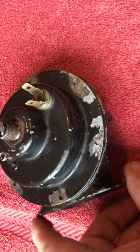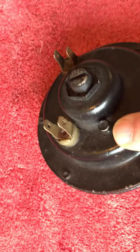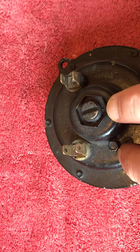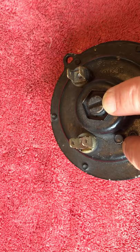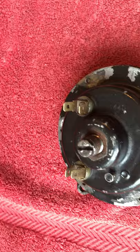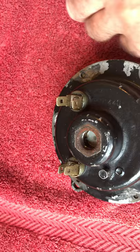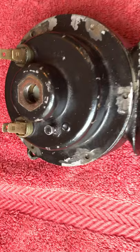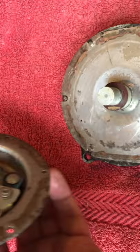The only things you get on the top: there's the screw that adjusts the contact points — not that you can adjust them particularly for much purpose. And then there's this lock nut, which is 19mm. You can take that off — just an ordinary gripping nut. Take that off and then you can unscrew the centre bolt. So that's what I did first of all: I removed that and removed the centre bolt. Then I ground off the six screws using a Dremel, and lo and behold, you can lift that off — and that's what's revealed underneath.